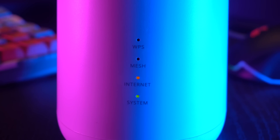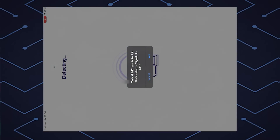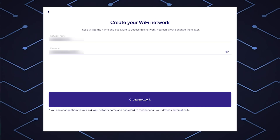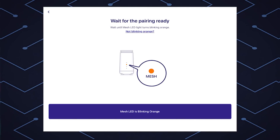If the LED is orange, the Wi-Fi router can't access the internet yet. Scan the QR code to connect with the Dynalink router. Once connected, input basic information like where your Wi-Fi is located, select the type of internet connection, and create a Wi-Fi name and password — you can go creative and put anything you like. You can also add the Dynalink mesh Wi-Fi node by powering on the unit and opening the app. Wait until the LED of the Wi-Fi point turns blinking orange and it will automatically connect.